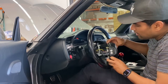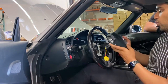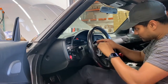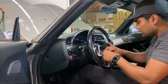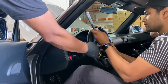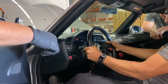Once you remove the two bolts, slide the airbag out carefully and disconnect it from the steering wheel. Now you're going to disconnect the remaining plugs, which includes the cruise control and the ground wire. At this point, you're going to crack the bolt loose, but make sure you have a good grip on it, unlike me. From here on out, you want to make sure the steering wheel is always centered at 12 o'clock. You're not going to take the bolt off all the way, because you're going to use that to keep it in place so the wheel doesn't fly and hit you in the face.